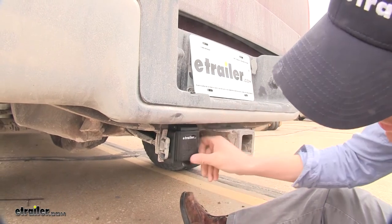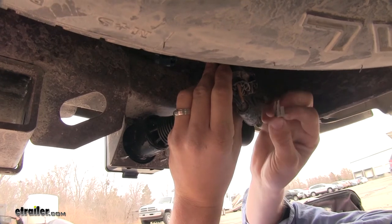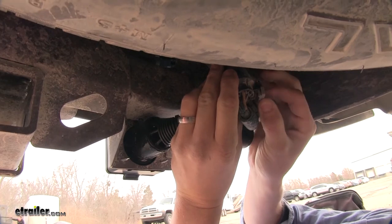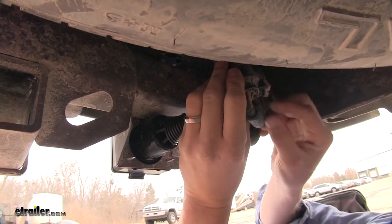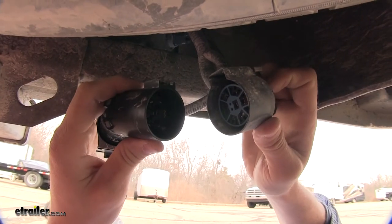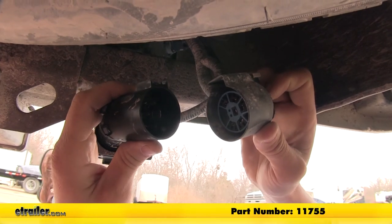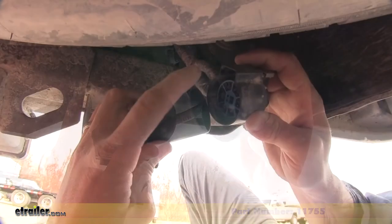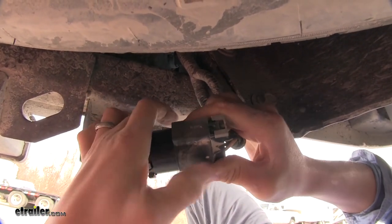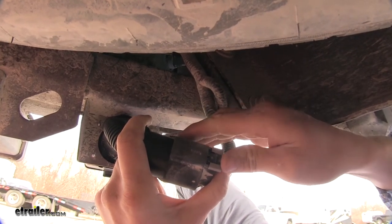With all of our hardware in place, let's go ahead and connect the back side. Here on the back side with our factory connector, let's get it ready. If your gray tab came all the way out, go ahead and push it slightly in until it clicks — it should look something like this. Now before we connect it, if you'd like to put some dielectric grease on there, you can pick some up at eTrailer.com — that's just going to help protect your connections. Now we'll line up the two notches and push it in place. Once you've ensured it's all the way on, go ahead and hold it together and push in the gray tab.